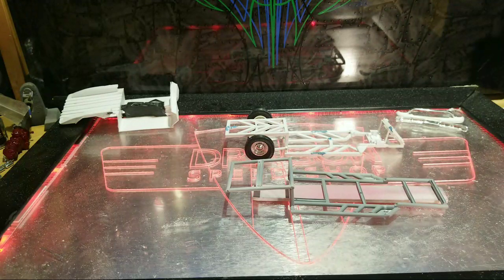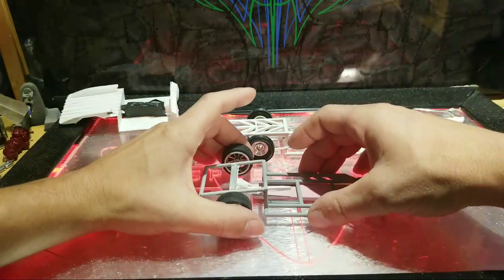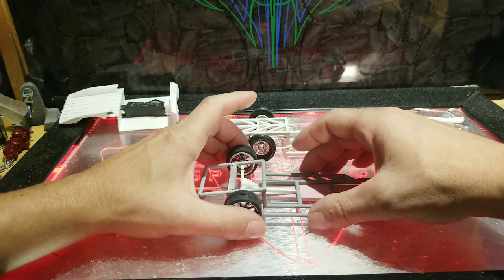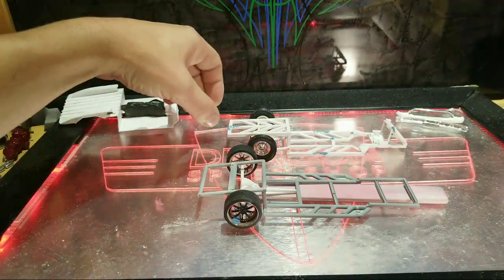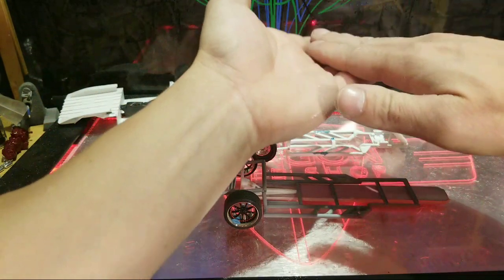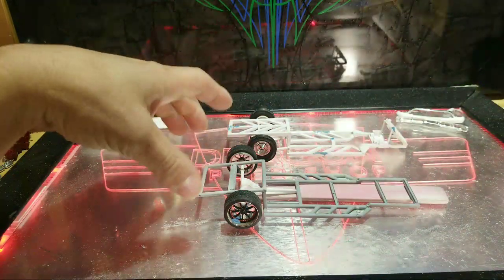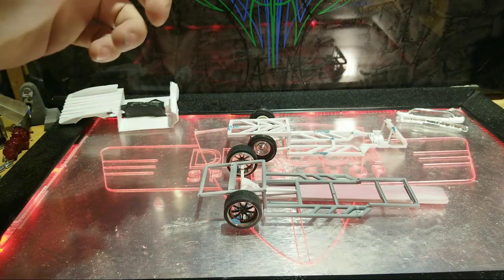The next thing I would do is get the wheels and tires you're going to use and your axle that you're going to use, and then you can figure out how much you need to cut your frame. The Oldsmobile, this top cross member here, the top part of the frame, is sitting right on top of the axle, so when that suspension's fully compressed, that's kind of its bump stop. This one's not, it's riding on leaf springs, so I've got a little bit more clearance there for that.